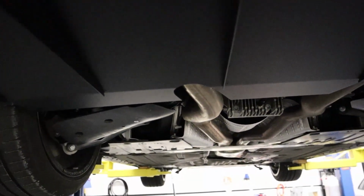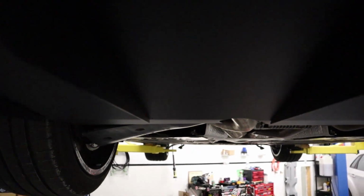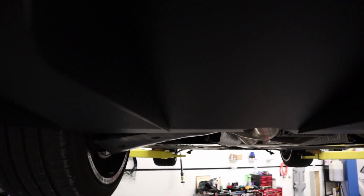Another spot that you can actually check longitudinal flatness, or parallelism, I guess, would be the bottom of the strake. And that is to ensure that the performance of the diffuser matches what our CFD tests show. And that is basically flat with the underbody of the car.